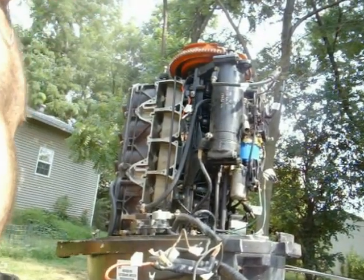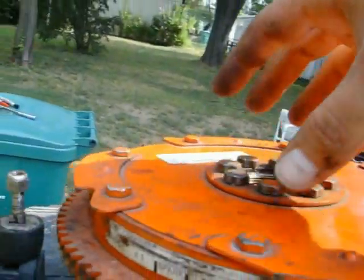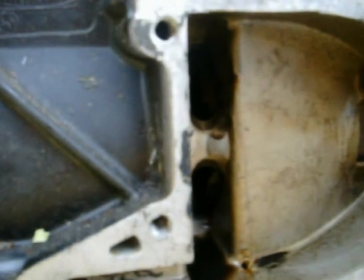By turning the flywheel you can rotate all your pistons and get a good look at all of it. Next step is probably taking apart the flywheel — there's a grooved ring in here that's threaded; they sell a flywheel puller you can put in and lift this up with your cherry picker. Here's a look at piston one — it looks loose. But the other ones are not looking so tight; they look like they've expanded a lot more. Down here on three — the other one in question — you can see they're clearly stuck. There's no gap off the actual piston. I don't know if something will just loosen them up or if I want to jeopardize that at this point.